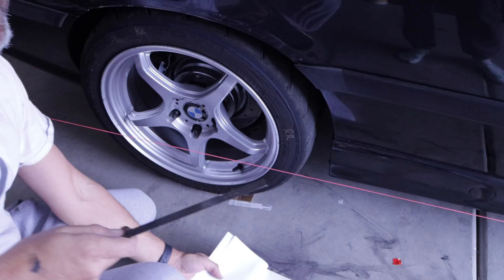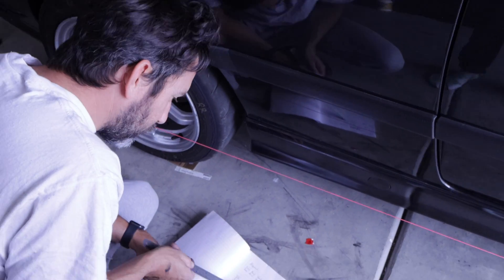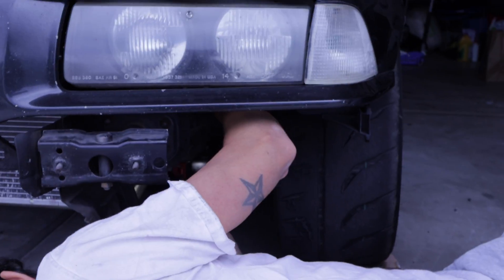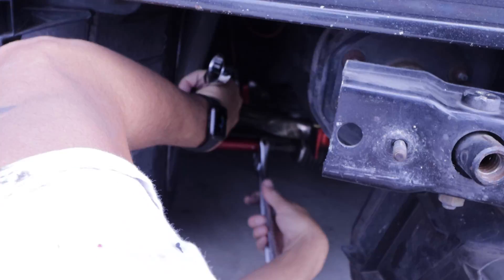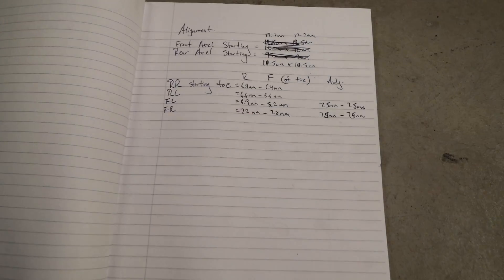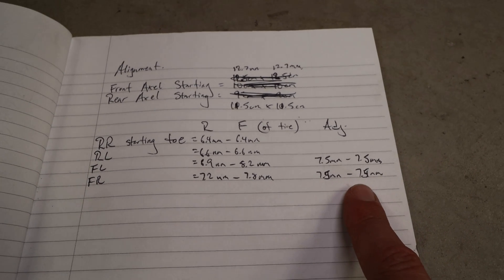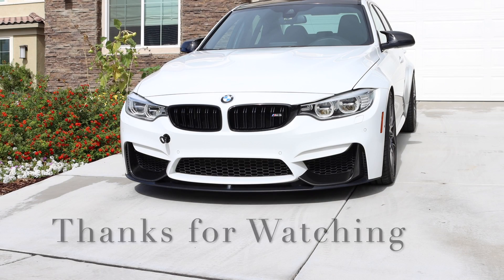Now that we have our initial measurements, we're going to start adjusting the outer tie rod on the front and measuring the front and rear of the rim to get our toe back to square. It takes a little bit of adjusting on both sides, but ultimately we got the car dialed in at a 7.5-millimeter measurement front and rear for the driver's side. Thanks for watching — don't forget to hit like and subscribe.